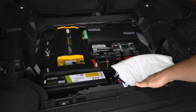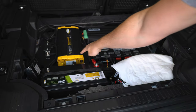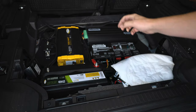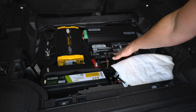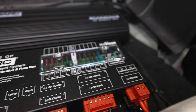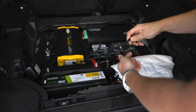With the third row seat removed and the custom panel popped out, you get a great view of how much space is available underneath the storage area of the Defender. The big thing in white is the factory air compressor wrapped in insulation to keep the noise down. We've got a 100 amp hour lithium battery mounted here to power all accessories, a GoPower 1000-watt pure sine wave inverter, the dual-part RedArc RedVision system — their BCMS battery charger — and a distribution block. Rather than running all wires to the battery, one cable goes into the system and you cleanly wire all different loads into the quick connects. We've got our charger, auxiliary battery, all the 12-volt outlets, and the hardwire for the Dometic refrigerator.